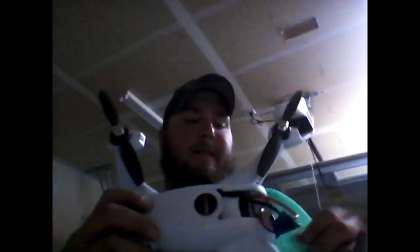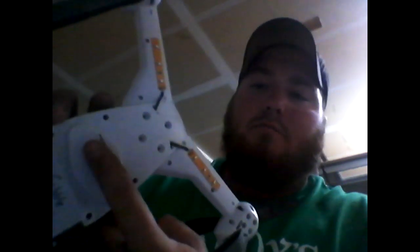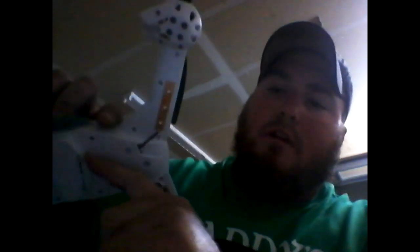However, you can see that. See the back end is bent down there. That's because it's hitting on that guy right there. So what I'm going to end up doing is taking that mount back off and trimming that piece back. So, hang on a sec. Okay, I've taken the mount off, and what I've done is mark my line where it hits. And so I'm just going to take a hacksaw, cut right along that line, and then cut right along here until she falls off.